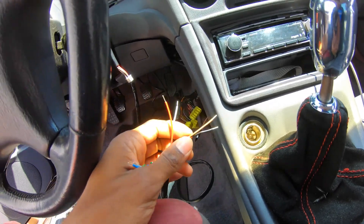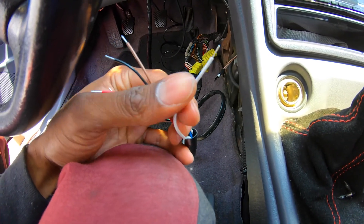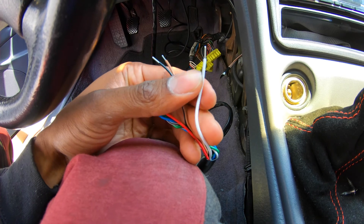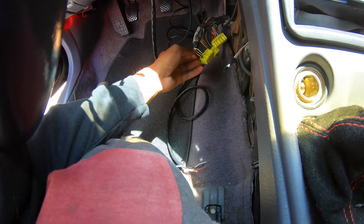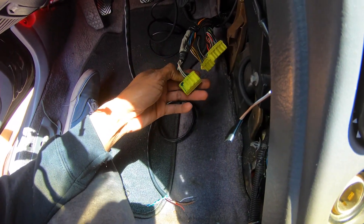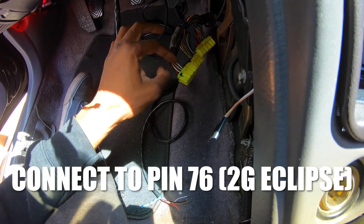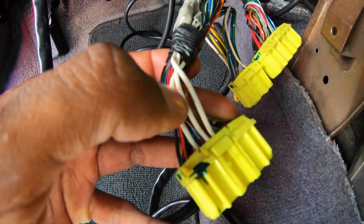The brown and black wires I'm going to solder together and put on a ring terminal to ground to one of the ECU mounting bolts. Last but not least, the white wire is the analog output wire that needs to go to the front O2 sensor pin on the ECU — it should be pin 76, which is the middle of those three wires.